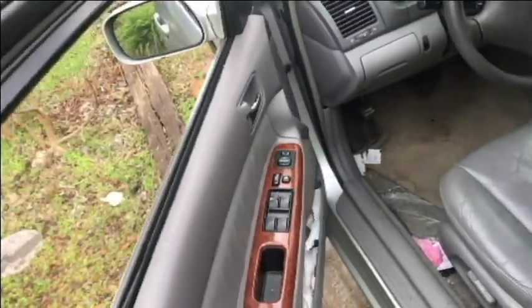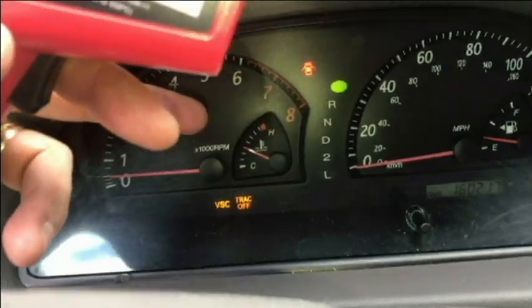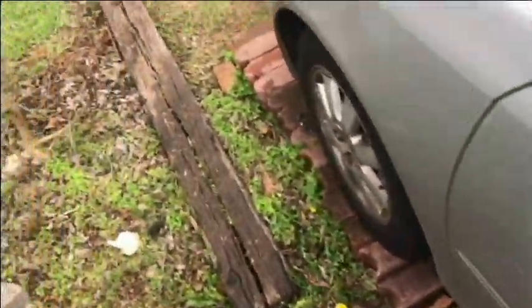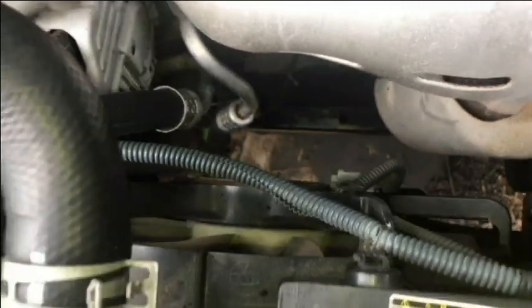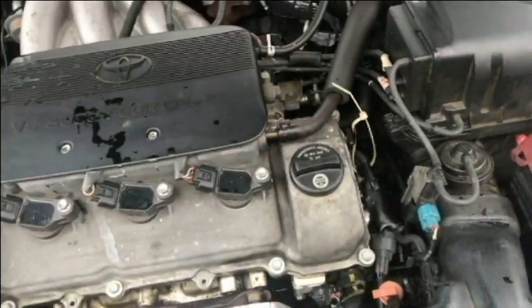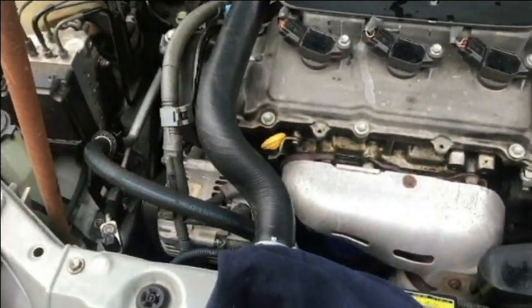That sensor 3, right above the thermostat, seems to have been the problem. I'll probably go ahead and change the other sensors too. You can see the gauge is where it should be. I'll probably drain that coolant, because it does need to be drained, when I change the number one sensor — or sending unit — down there below the radiator, and number two, which is right over here. I guess I'm going to end the video because the fans are working now and it looks like it was that number three. Until next time, thank you for watching. Have a great day. Hope this has been helpful. Take care.